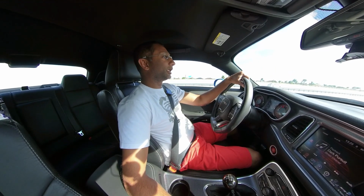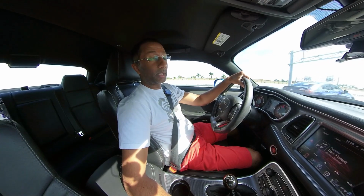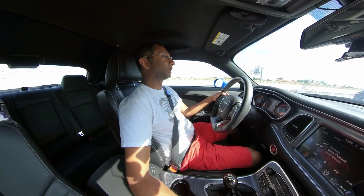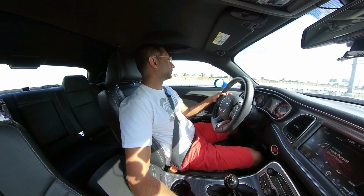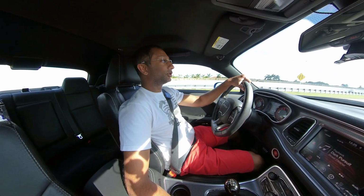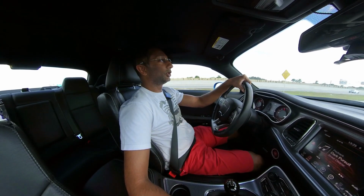First thing, when these cars came out, number one things people were talking about on the automatics were, yeah, you put some sticky tires on this and you're blowing up the drive shaft, blowing up the half shafts, that kind of stuff. Why aren't people running into the same issues with the manual? And that's mostly because your clutch is going to be your weak link.